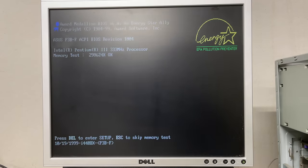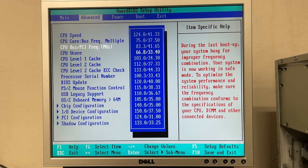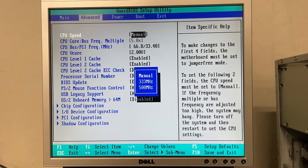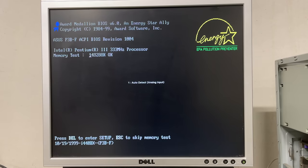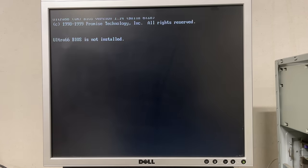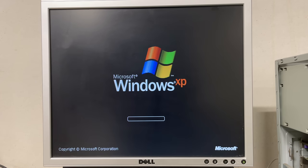Let's start her up - I'm not expecting any big bangs. It's starting up as an Intel Pentium 3 running at 333 megahertz, which is a bit odd because I don't think there is such a thing as a Pentium 3 running at 333 megahertz. During the last boot the system hung for improper frequency combination, so we need to set the proper frequency. I'll leave it by default and see if we can boot. After saving changes and rebooting, it's picked up as a Pentium 3 at 333 megahertz with 320 megabytes of RAM, the Award Plug-and-Play BIOS, a hard drive, CD-ROM drive, and an Ultra 66 card.